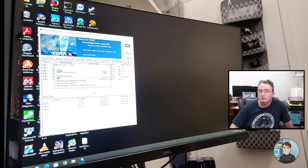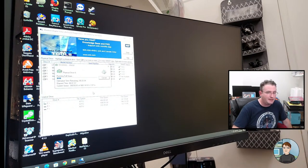Well, we could put in another drive, reinstall Windows 10, and see if that clears up the problem. Clears up the blue screen and error. Zulu says, why are people so afraid to format? It's likely the most refreshing method. Chris says, reset BIOS to defaults and run mem test. Well, we upgraded the BIOS. That would have reset it back to defaults, correct?